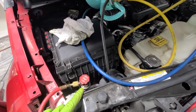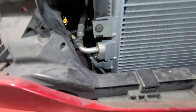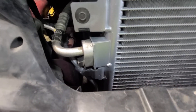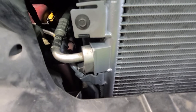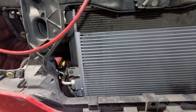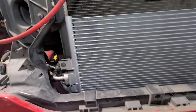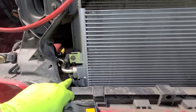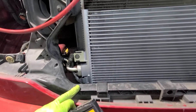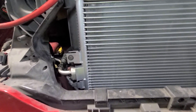I am going to leave it running a little longer to see if we get this line to sweat a bit. If that line sweats, that means the new condenser is clogged. We know that definitely this new condenser is clogged because it is getting too high a pressure here and it is jumping too much of a degree in the short section. That line is sweating, which means there is a clog between the high side line and the compressor. The only thing in between to clean is going to be either an orifice tube or the condenser.